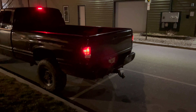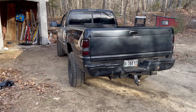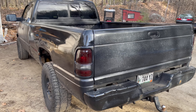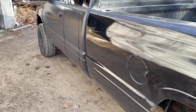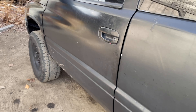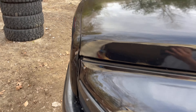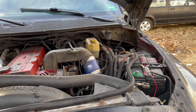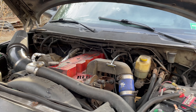For some reason my brake lights are on — that's not supposed to do that. I drove this old thing home last night and the brake lights kind of fixed themselves for a little bit, but not completely. When I got home they were still stuck on. I did however have my speedo and my fuel gauge back. So I am going to basically go over all of the grounds on the truck and clean the hell out of them, put them all back, and see if we've made any progress.